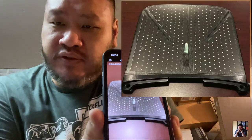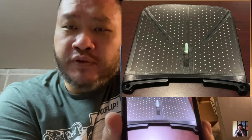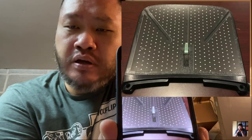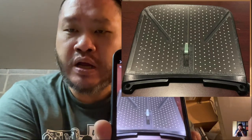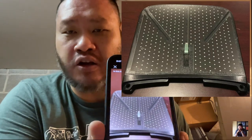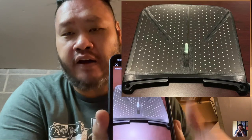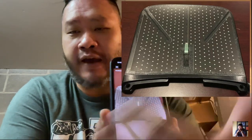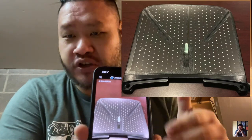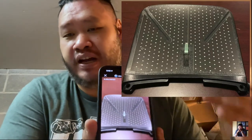There's some kind of footpad issue to start. I want to make sure everyone gets an idea of what the sensor looks like underneath the grip tape. This image from Jeff on the TFL subreddit shows basically one giant layer of velostat - the black material - and where we see the silver dots, that's the conductive trace material. Think of it as fancy aluminum foil printed as a circuit board. You have a giant circuit board separated into a left half and a right half, and the velostat - a black plastic conducting material - closes the circuit to indicate which side is engaged.